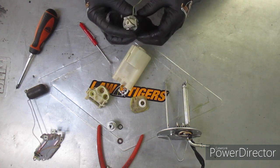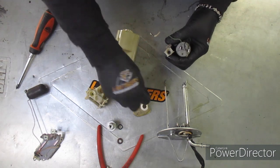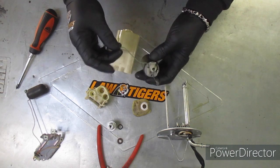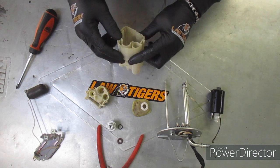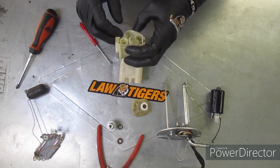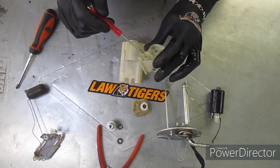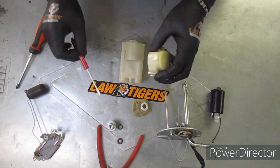Anyway, this is the pump and it's got its own little rubber O-ring right there. It goes back on there like that. There's a little cap here and then you've got another O-ring that goes here. I'll bench test this and make sure this pump still sounds good. And see, you got all that dirt in there. It's kind of dirty in there — little black particles. Believe it or not, there's a filter right here, so I'm going to go clean that out, put it in, and see what we can get out of it.